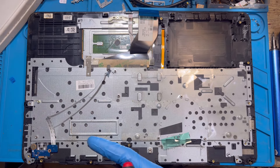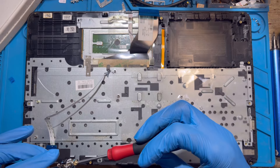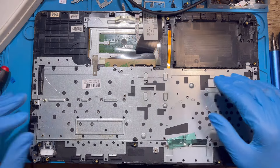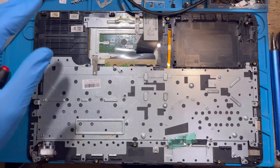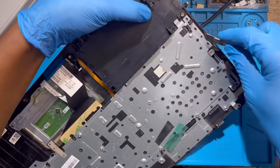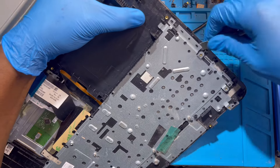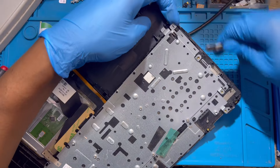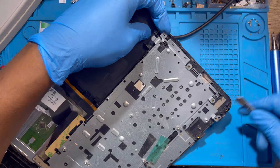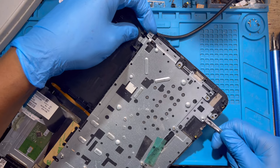Take out the on and off button because the panel is closed under there also. Make sure you take out all the screws and remember where you removed them. After you remove everything, remove this panel — it has no screws, it's just clips. You have to force it open. After you finish, you fix it back with solder. Just try to open it like this — there is no other way; you have to open it with force because there is no screw, it's just clips. Open the clips carefully, step by step. Take your time and open it slowly.